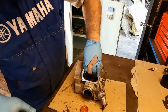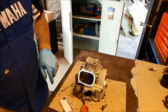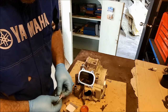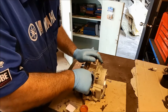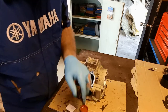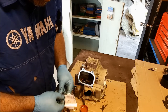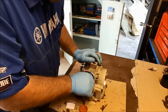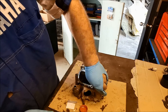On this particular engine, all the valve stem oil seals are the same, but on your particular engine if you're doing a different one, it's a good idea to double-check that you're fitting the right seal to the right side. Otherwise, if one of these comes off — and that has happened to me in the past — she's going to start to lose oil. These things are cheap, and to replace them now takes no additional labor whatsoever. In fact, they have to be replaced on this job. If you're doing a head overhaul, just put new ones in.